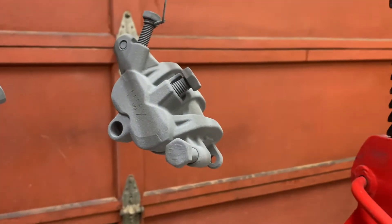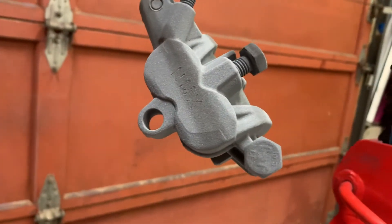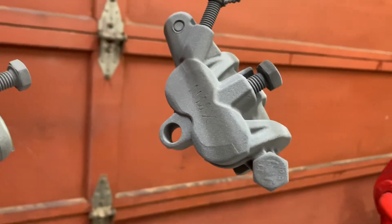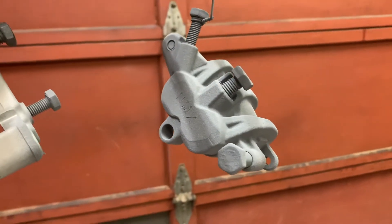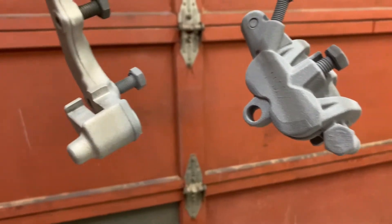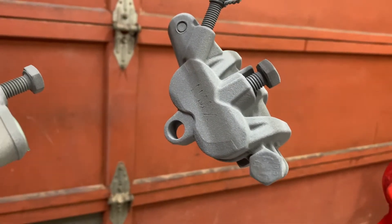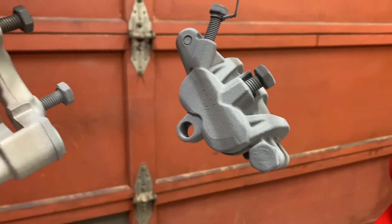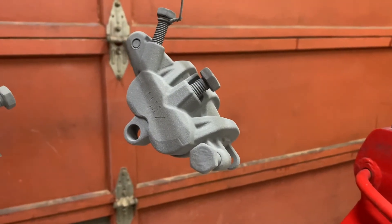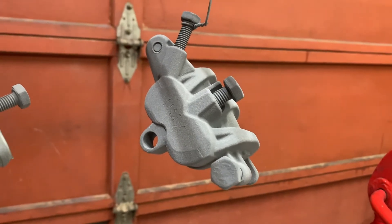That's what it looks like before you put it in the oven. It's going to turn into a chrome finish, but as you can see it starts out as almost like a really flat, matte silver. I'm going to do these pieces one at a time. I'll take this right off the rack and do them one at a time because you've got to let these cool down to a certain temperature, and these pieces are going to cool down at very different rates. So I'm going to do them one at a time to achieve the look I want. Putting this in the oven right now.